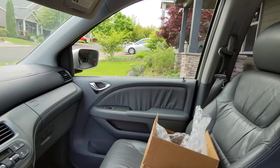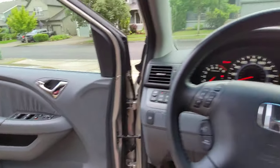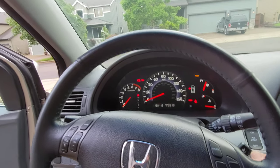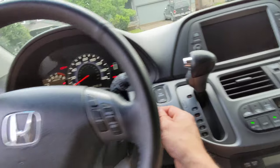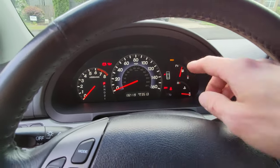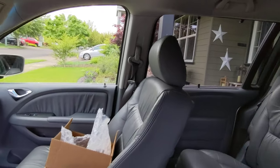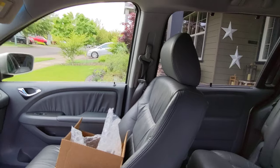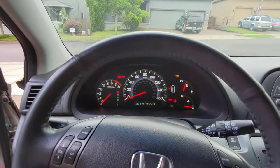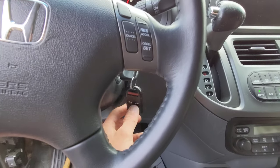Interestingly enough, the indicator would go off if I plugged in the driver's side seatbelt — just doing that would turn off the passenger sliding door icon. With that undone, having the light on was preventing us from using the remote to lock and unlock the doors. We also needed to replace the door lock actuators. But with the seatbelt buckled, the remote started working again.